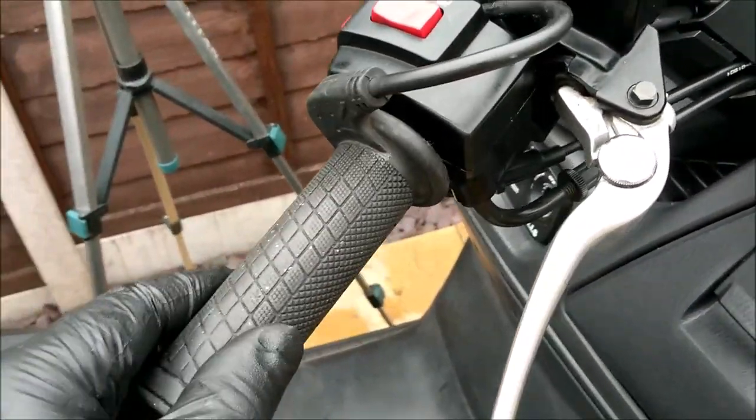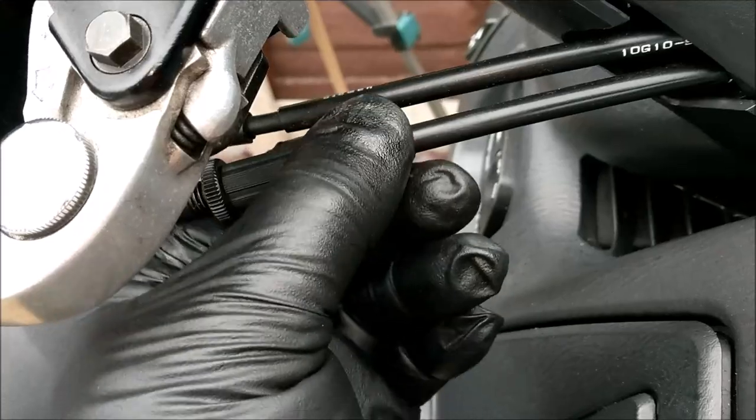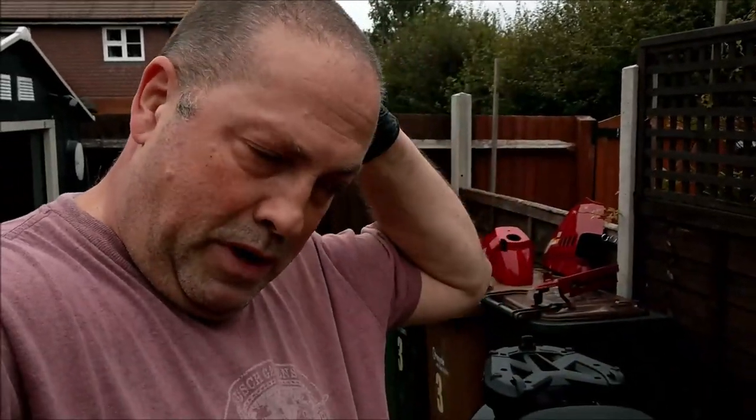All good. Everything's good. But I did find that the throttle cable was tight. And one of you guys, thank you very much, commented that it's revving a bit high. I think you're right, but again, the engine was fairly cold, so the choke was still on, effectively. It comes on automatically when it's cold. It's probably a wax type, thermostat controlled choke. It did settle down to between 1100 and 1200 revs when warm, and you could hear that noticeable drop down.